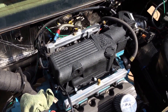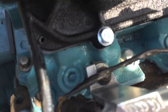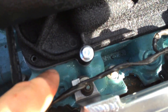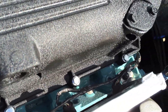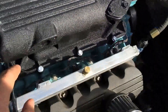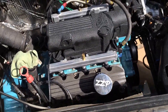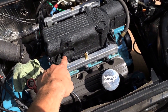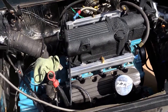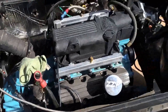This whole intake I modified quite a bit. First off, these plugs down here — those were the stock ports for the injectors, but since this is an L67 it already has injectors in the heads, so I had to get all those plugged. The evap sensor went right there, so I plugged that with a freeze plug because I don't need it.